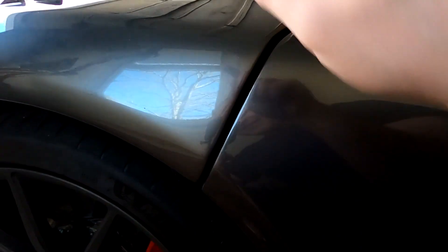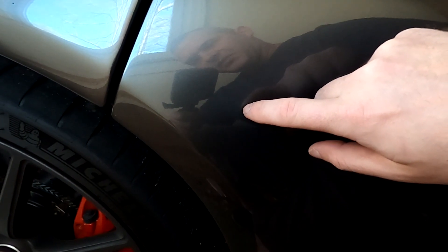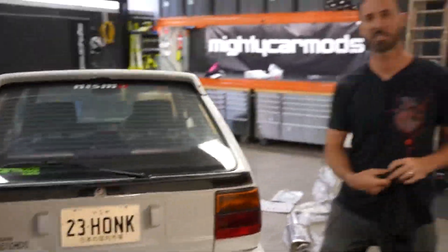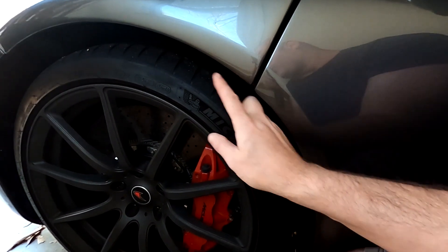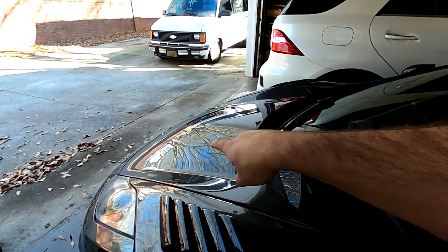That's what we're going to go over today. I actually did reroute mine to where it's supposed to be in the door jamb, but we may have to modify that on the fly. Here's what we're going to do: first step, jack up the car; take the wheel off; get access to the inner wheel arch; pull the cable to get the front lid open.